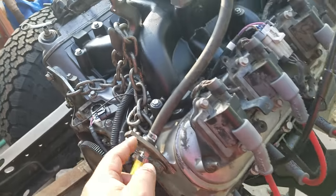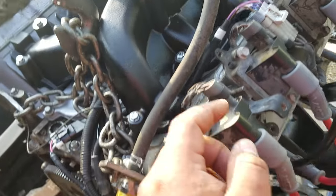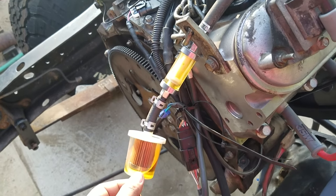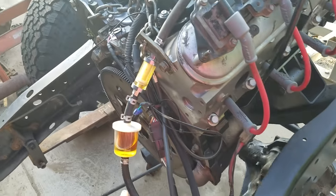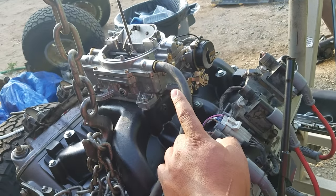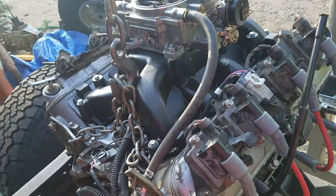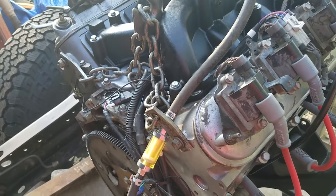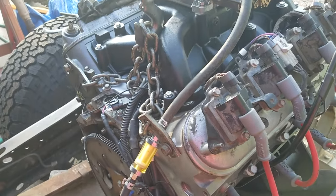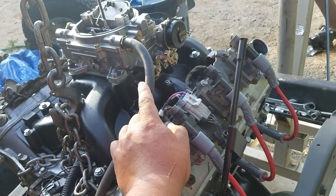You can run your PCV or not — it's up to you. With an LS you're going to have to run an electronic fuel pump. I'm using a TBI pump on the Edelbrock carburetor; the TBI pump pumps sufficient fuel to keep it running. If you're going to use a Holley carburetor like a 4150 or 4160, a TBI pump will just blast through the seat and you won't be able to get it running without flooding.